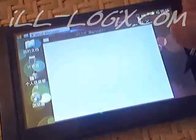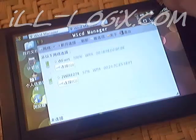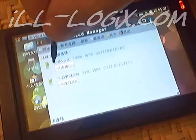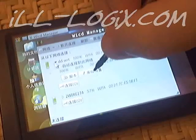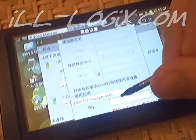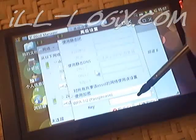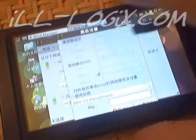You will have a task button pop up. Now to set it up, what you are going to do is click this little arrow right above, right next to your router. Then you are going to go here — a little file — and then this will pop up. If you are using WEP encryption, you select this tab here and select WEP. If not, like I am using WPA, you will enter your information in here.